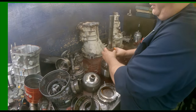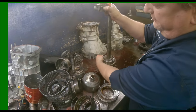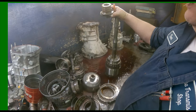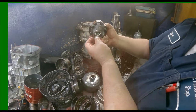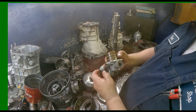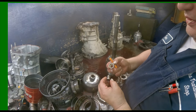All right, this is gonna slide up now. We got our keyway. It goes in right here. Some of these are really small, so I'll keep that separate also because it's going to fly away. Then our weight's going to come out from the inside. And yeah, we're pretty worn out. It's governor time. This should be a gold color. It's all gone.